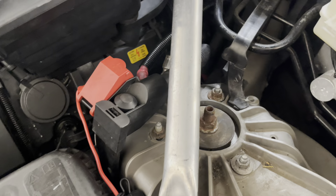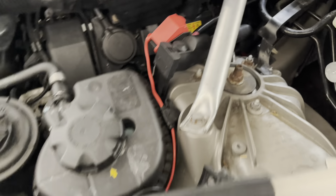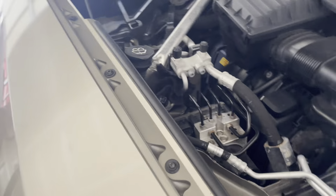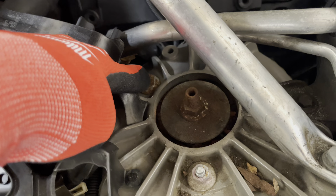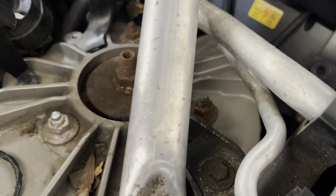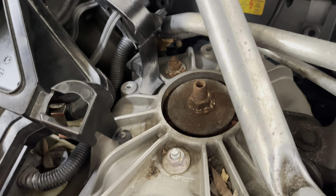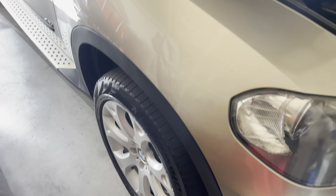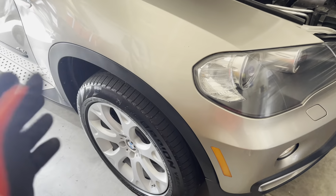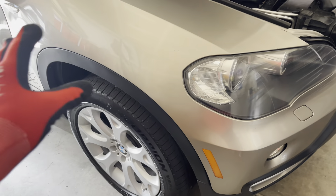So what I'm going to do now is on the top sides I'm just going to put some PB Blaster on it for now. I'm going to take a picture to note where the bolts for the struts are sitting. PB Blaster is going to be necessary for sure. I would bet these have probably never been out. Let's get some PB Blaster on the top and then we're going to start by taking off the wheels on both sides. Jack the car first, put it on the stands.